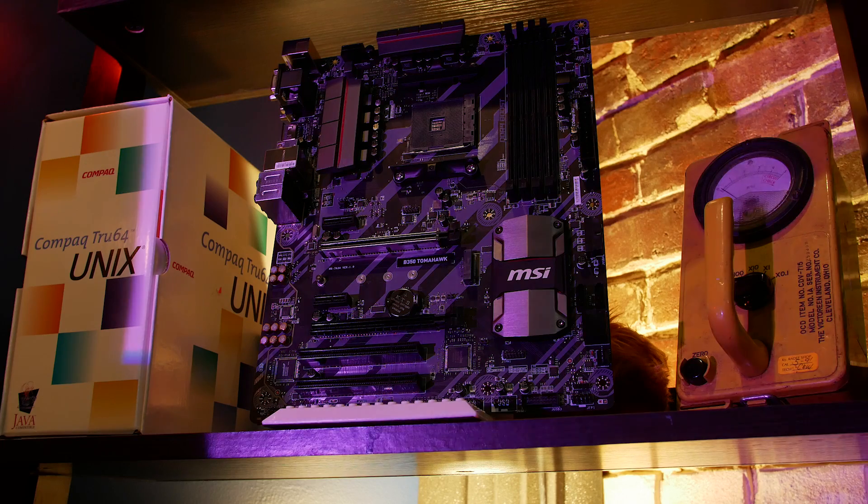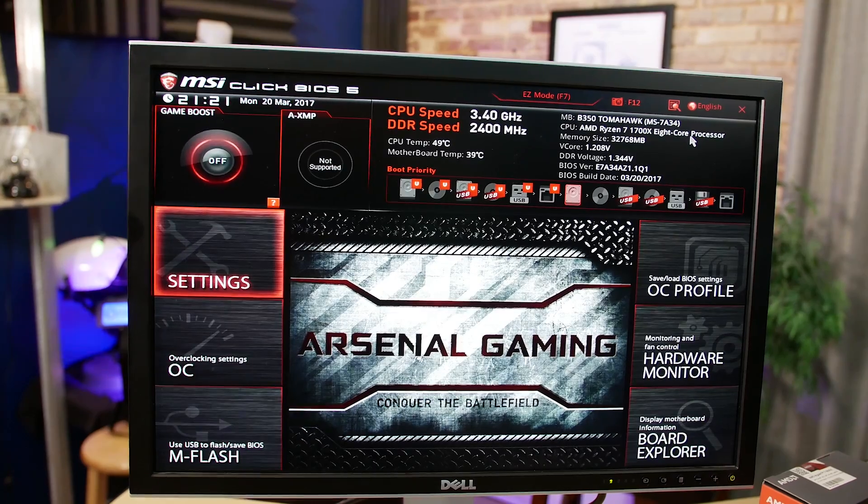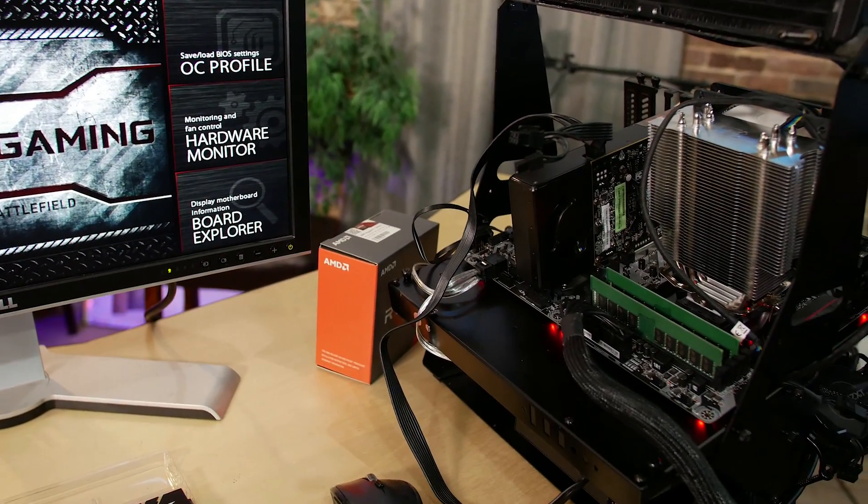If you want a digital workstation with eight cores instead of six, go for the 1800X CPU — it will drop right in and the system builds exactly the same way. If you want a CPU a little less than the 1600X and don't plan to upgrade later, you could get a B350 motherboard, which runs fine with Ryzen 5 and even Ryzen 7. The Ryzen 7 1800X has worked fine in every B350 motherboard I've tested, though some can't deliver a lot of power for overclocking. Keep in mind the 1800X is a 95W TDP CPU, so it won't consume crazy amounts of power. But if you're getting a high-end CPU, get a better motherboard — don't pair a $70 motherboard with a $500 CPU.